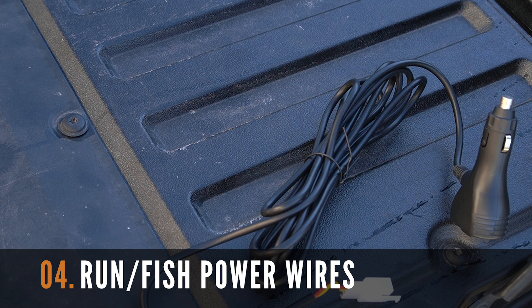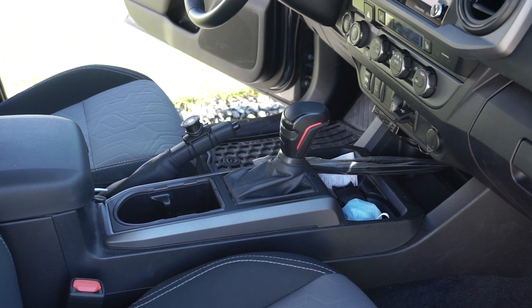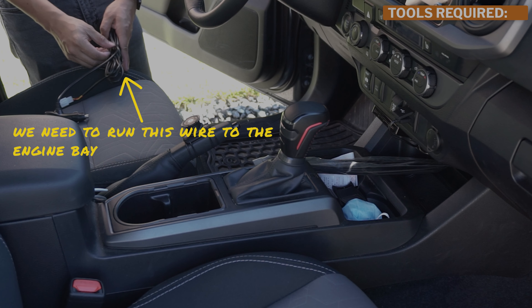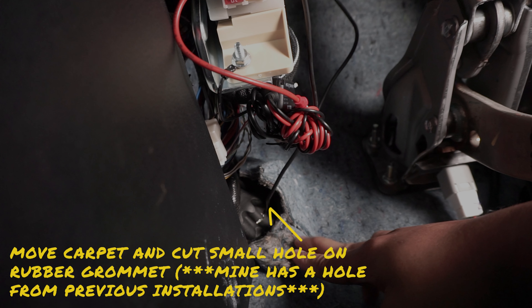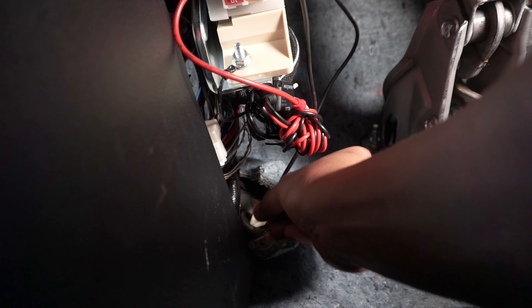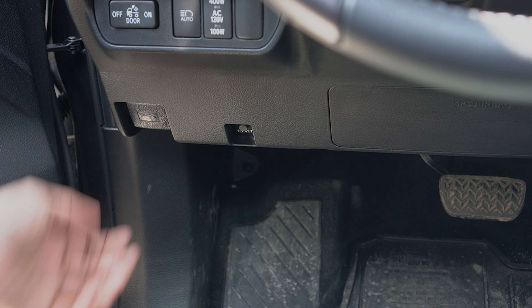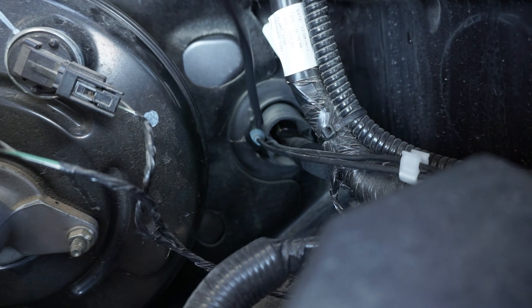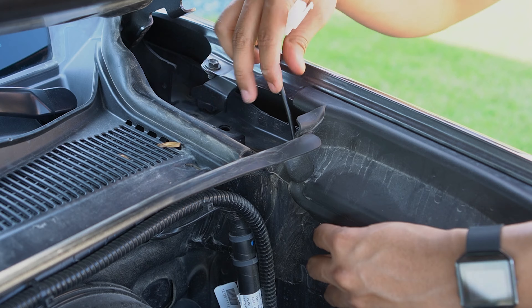After installing the light bar on your roof rack, we'll now need to run the power wires from the truck's interior into the engine bay. If you haven't done this previously, you're going to need a sharp cutter for this step. This is required so we can power our light bar. You need to pull this carpet back and around the cutouts and slice a small hole on the rubber grommet about the size of the wire that you're going to run into the engine bay. Since I've installed other accessories before, mine already has a hole. Simply insert the wire in the hole and this should come out of the engine bay. Then open your hood and start pulling the slack out of the wire from the engine bay. We're going to need to run this wire up to our roof rack through this plastic panel cover, all the way up to this corner panel.